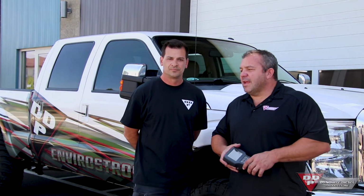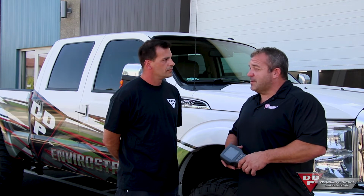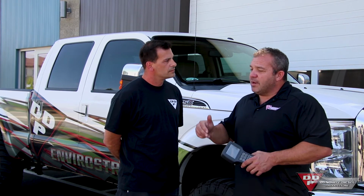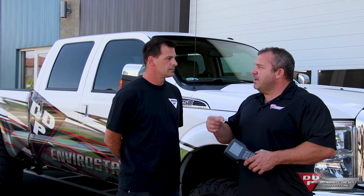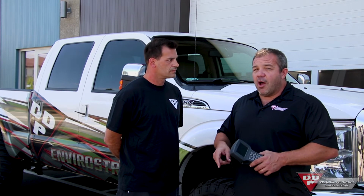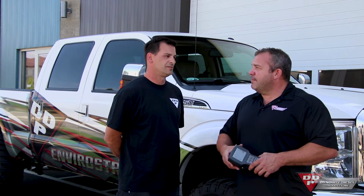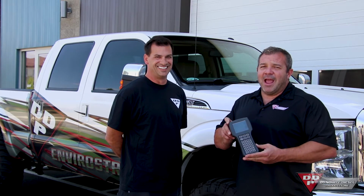So Adrian, you've mentioned volume and pressure. One of the things that we've been learning over the past few years, especially on the common rail side of things, which we're now retroing back to mechanical, is that if we can keep the volume going not only to the injector, but to the actual nozzle, that volume increases pressure. So when you start staying on the gas pedal, instead of pressure falling off at the nozzle face, we keep the volume there, the nozzle face sees the volume, it keeps the pressure up, and boom, atomization's a lot better. Exactly. And this little guy is way happier.